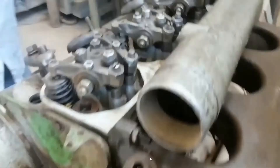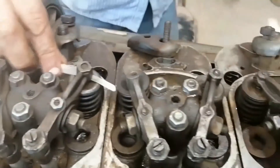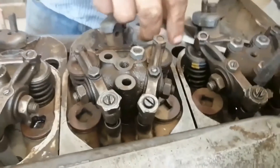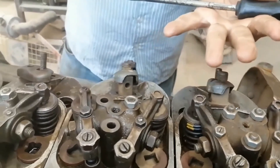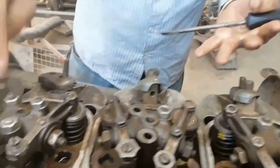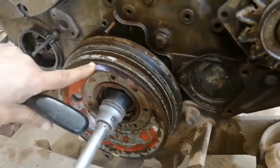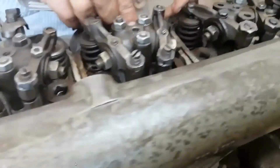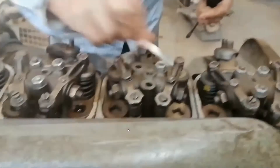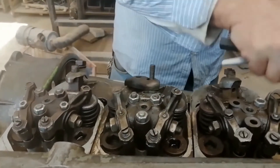We make marks here — two points here, one point, and at the bottom also. So at every mark we adjust one piston. This is easy because sometimes you can always follow the marks. It is a good method to see the mark without having to check overlap every time. When this mark or the next mark aligns with the front pin, you adjust the piston according to the firing order. In a six-cylinder engine, you will make three marks.